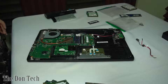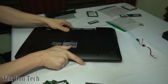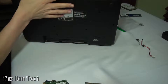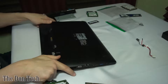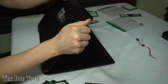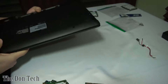Anybody can disassemble a computer — it's not that hard. Brute force will get you into almost anything. But putting it back together, that's where the finesse comes into play. You need to make sure you know your own amount of pressure that you'll provide and push. If you are not careful, you can easily crack an LCD or damage something else. I've been doing this long enough where I know how much force and pressure things can take. Usually you don't want to squeeze it against the LCD base — carefully squeeze it along to get all the plastic knobs aligned correctly. In this situation though, I'm a professional — kind of a do what I say, not what I do sort of situation.